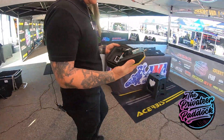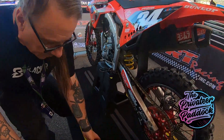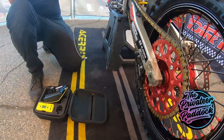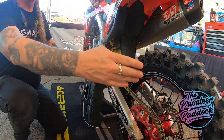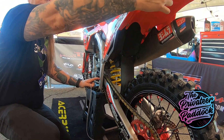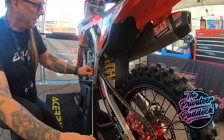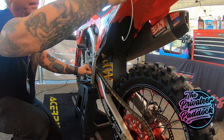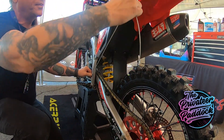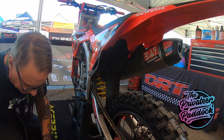So it's a really easy tool. You've got a super strong magnet that you're gonna stick to the axle. For Japanese bikes, you actually need to measure across the arc of the axle. For the Austrian bikes, you measure pretty much vertically. So for any Japanese bike, or like Beta or any other bike, you should do this — it gives you the arc of the axle, how that axle's gonna travel. That's where you want the retractable cable to hook up, right here.